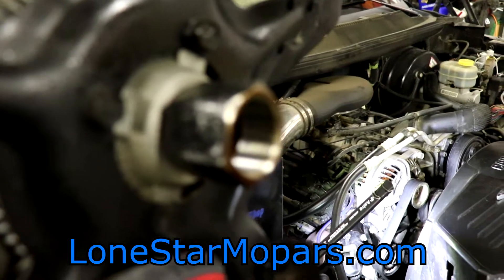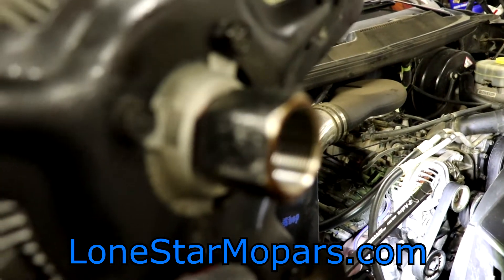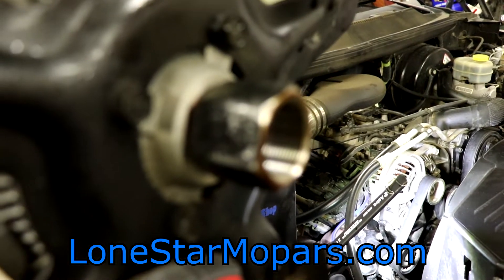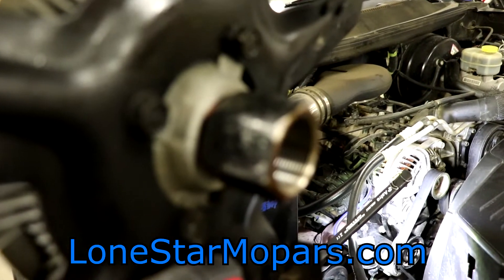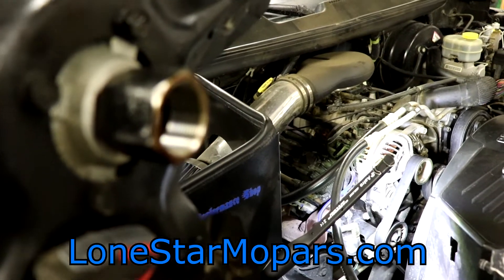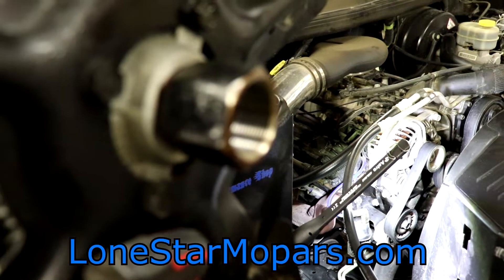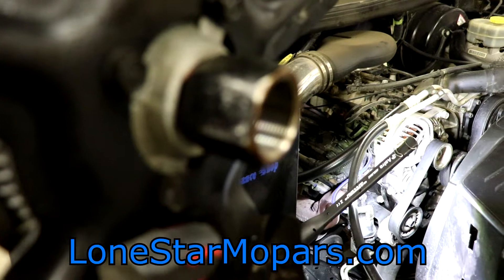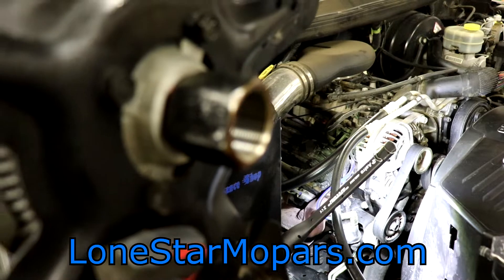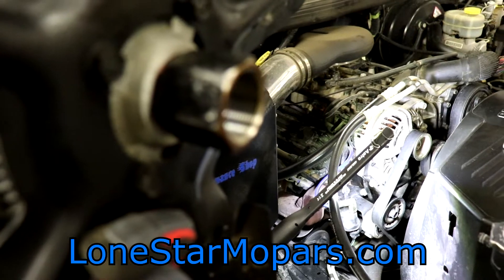Spoiler alert in case I forget — if you go back with the clutch fan, which most of us will do, get anti-seize, preferably marine grade, that's what I like to run. Apply it to the threads of your new water pump. Put some there so that if you ever have a hose fail or get a junk water pump from a cheap local parts store, the sooner you get this off the better. Putting the anti-seize on is cheap insurance.